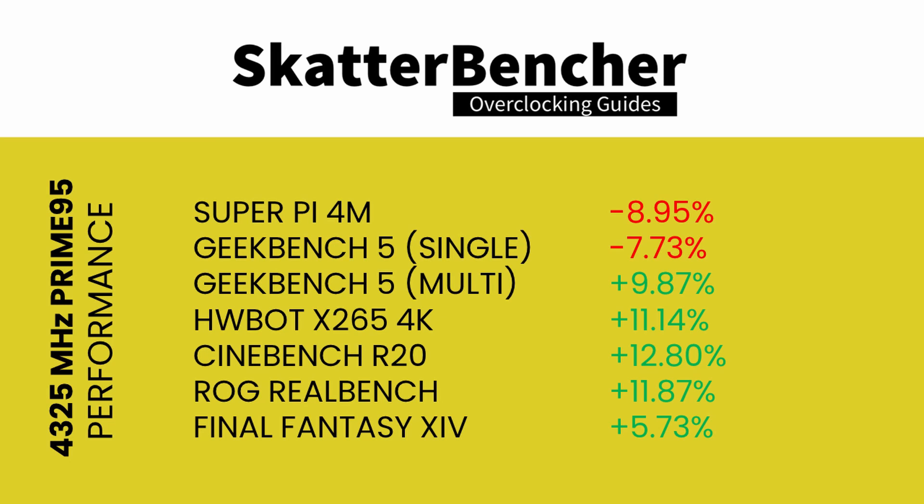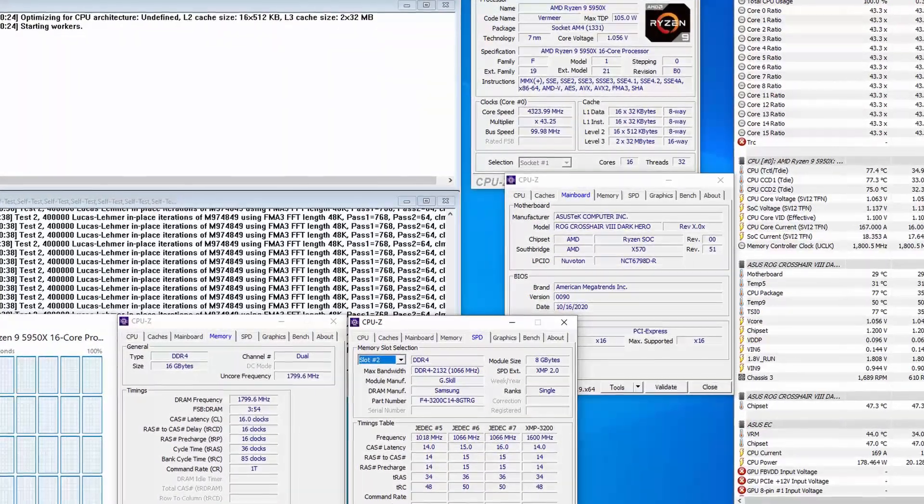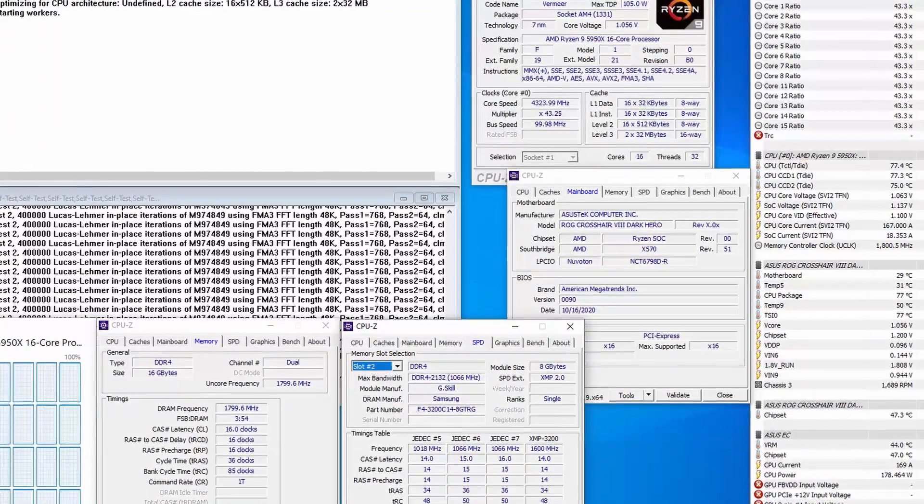After re-running the benchmarks, we notice a few things. First, just like with previous-generation Ryzen CPUs, we lose performance in single-threaded light workloads compared to default, because the default frequency boosts to almost 5 GHz while the manual overclock is limited to 4,325 MHz. Second, the additional fabric and memory overclock has a positive impact, helping overcome some of the performance deficit. Third, in multi-threaded applications the CPU frequency increase is amplified by the raised fabric and memory clock. Running Prime95 small FFT with AVX at 4,325 MHz, we see peak CPU temperature of 80°C and peak CPU package power of 180W.